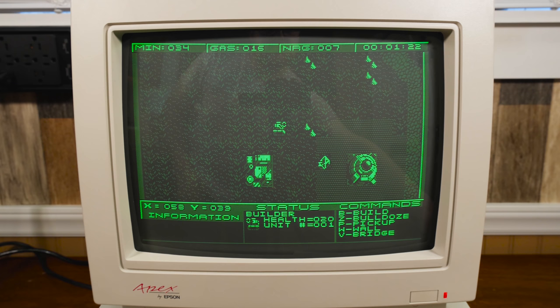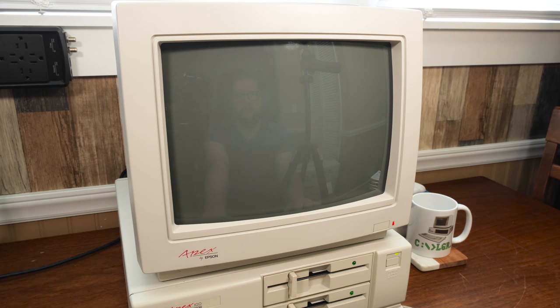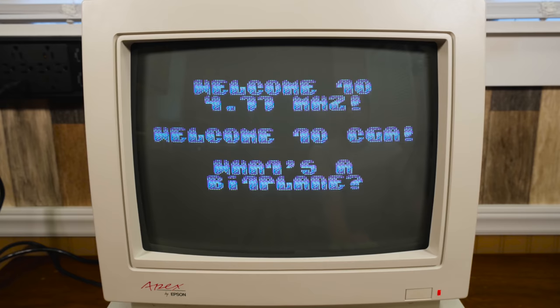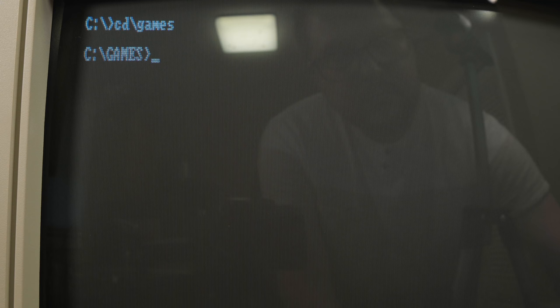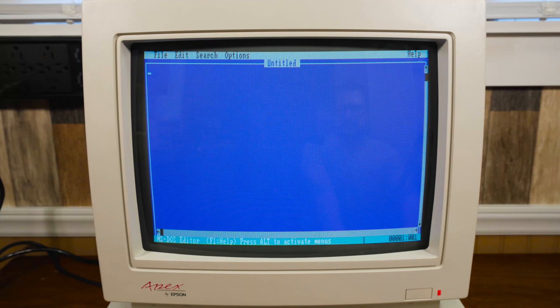It really just highlights the brightest colors like cyan and white. This feature is a definite first for me, though it was also featured on monitors from Magnavox and Commodore at one point. While its eye strain reduction uses are limited, the option is awesome without needing additional software or a real monochrome display. True Hercules mode is still available using the card's toggle switch around back. Something I didn't know this thing could do until the 8-bit Guy recommended I try it is 16-color Plantronics mode — the Epson MGA card features Plantronics Color Plus compatibility, providing a 16-color option for the few programs and games that support it. The display itself is captivating, with bright phosphors and notable scanlines that almost look artificially sharpened. With 80-column text clearly legible and faint artifacting giving everything a glow that oozes retro appeal — the look is close to the Tandy CM11, in my opinion.